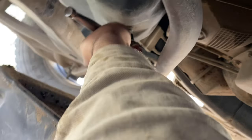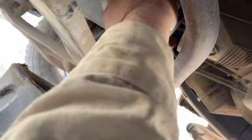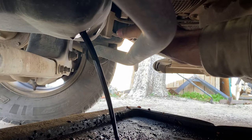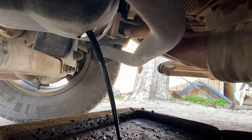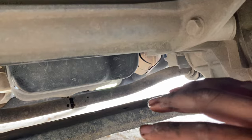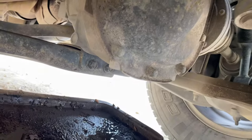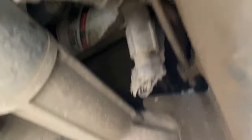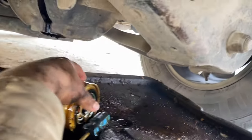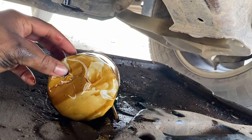See how it's in there? Just get to twisting it. See how black that is? That means it's time for an oil change — like way past due. So I let it drip out into the pan. Now I'm leaving the bolt in there just so I can move the pan over, because the oil filter is right there. I put the bolt back on, but let me go ahead and get the filter out. The oil filter should be hand tight, but as you can see, that's not the case. So let me go ahead and find another solution. I had to poke a hole and loosen it.